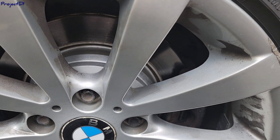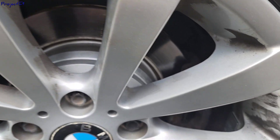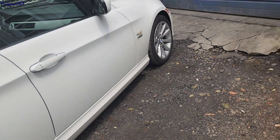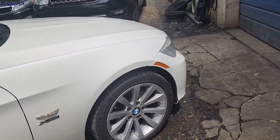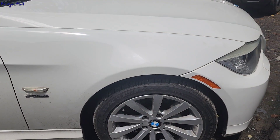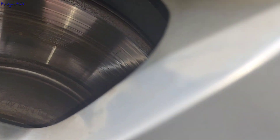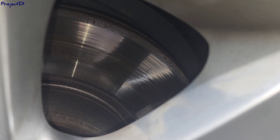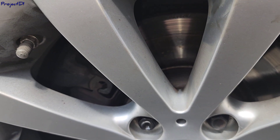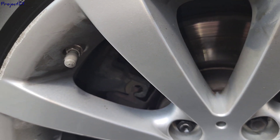Since something is going on with the front, we're probably going to replace the rear rotors also. I need to inspect those brake pads and see if there's something wrong with them. What happens in this case is the surface on the new brake pads is much stronger, and that braking surface most likely overheated the rotor — that's why this happened. So this rotor is done.